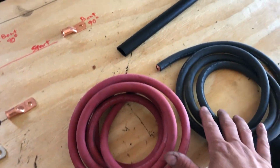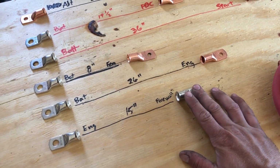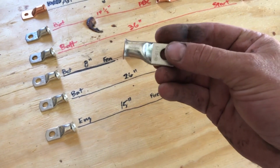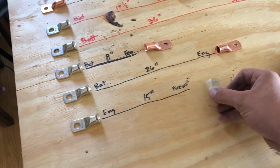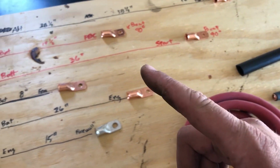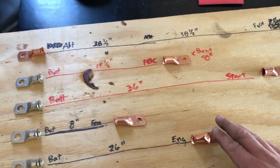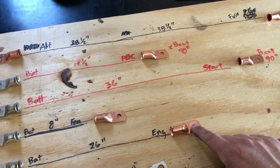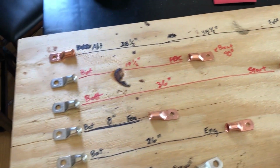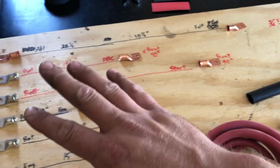With these wires, you also get 10 3/8 lugs. So it's these guys right here. 2/0, and then it's got a 3/8 hole. 10 of those. And you can see I've used some of them, which is good, but you're definitely going to have to pick up some more. So why not get a different size? So I ended up getting a 10 piece of these 2/0 5/16 ends. And you can see they kind of fill out the rest of it.